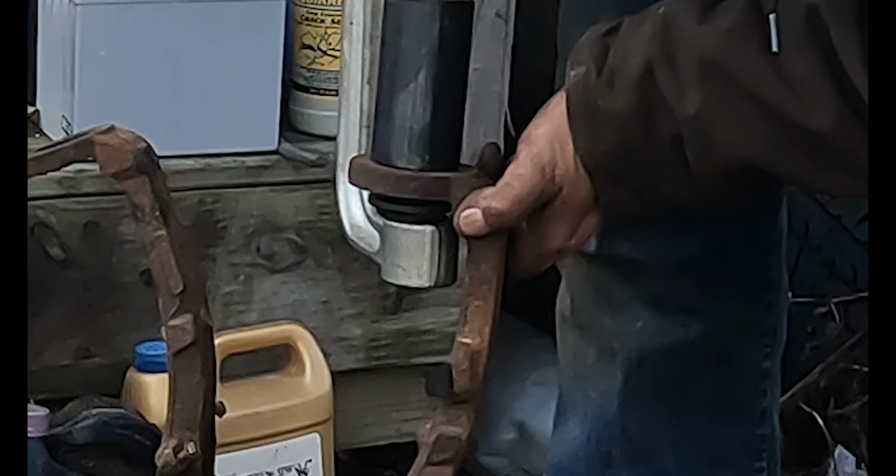And there's that. Alright, so this new ball joint has flats on the inside. It doesn't use an Allen wrench on the end. So it has flats here for a wrench, and then you would tighten down your nut. Makes life a little easier. On mine, the inner wrench was 17 millimeter, outside was 22. Got that all situated and tightened down. Everything is installed, torqued down.